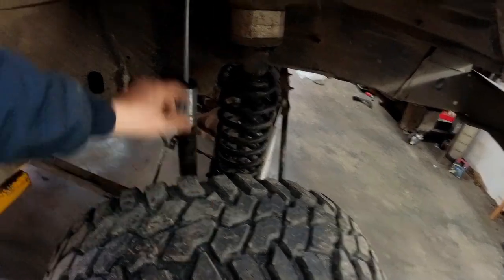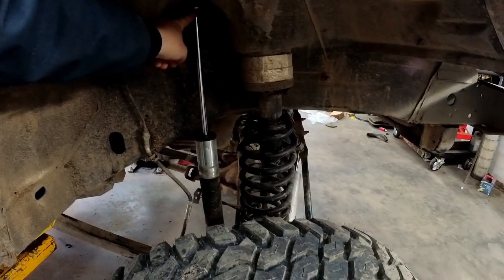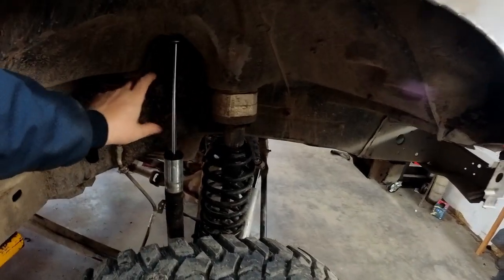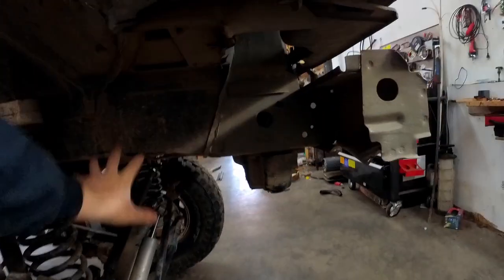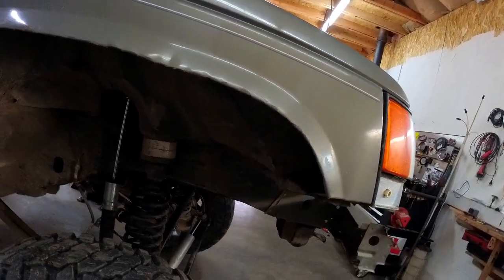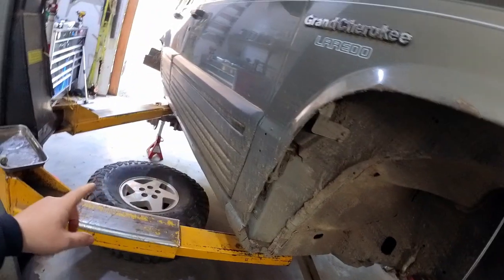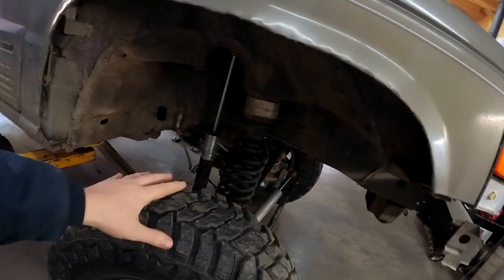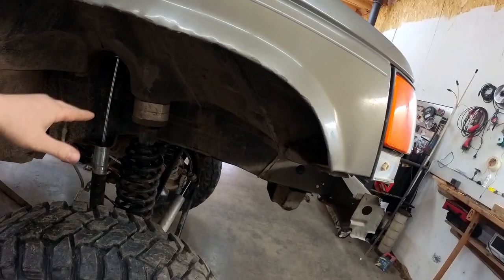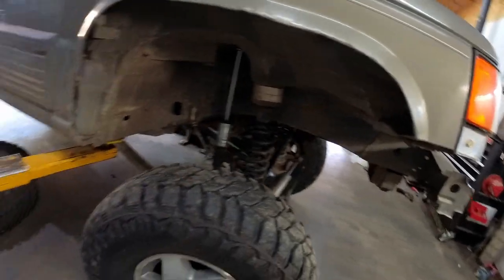The 35s were touching, so I had to increase my bumps, which gave the shock a bit more room. This ended up working out almost perfectly — it comes up about three-quarters of an inch when the bump stop contacts, so there's still a little wiggle room. I might put another hockey puck in there. Even after cutting stuff out and adjusting the body, you can still get some touching due to physics. My new spare actually got pretty well cut up by this joint, so now it stops short of where it'll touch — I lost some up travel but gained tire protection.